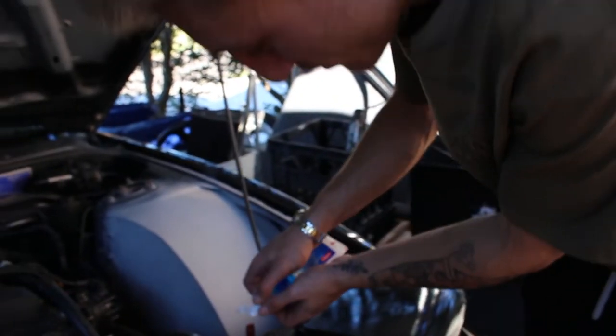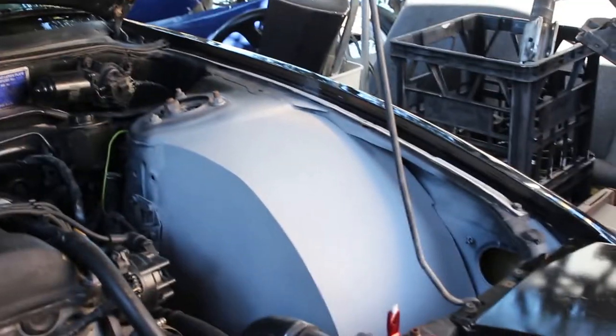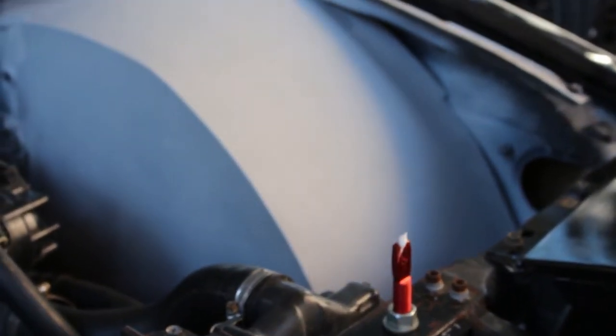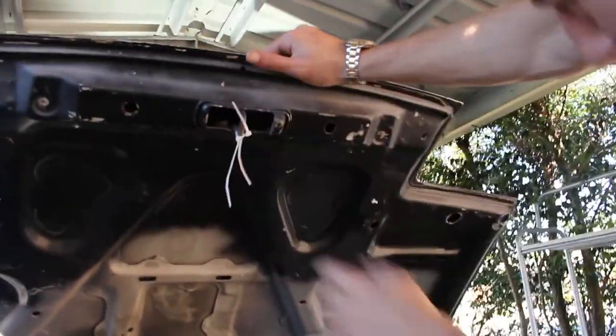So pretty much you're gonna just be popping a bit of toothpaste on the top there. What are you doing? We're brushing its teeth. No, removing your tools from your engine bay. Unlatch your hood. You're gonna mark the top of the pin, you just wanna let it sit there. Got a marking, as you can see. That's where the bonnet pin's gonna be pumping through.